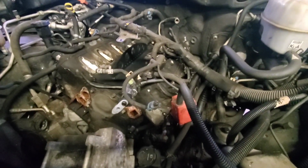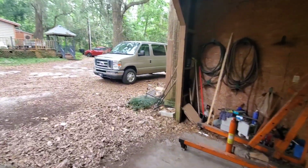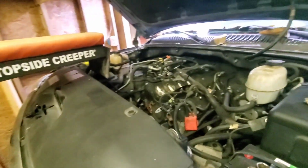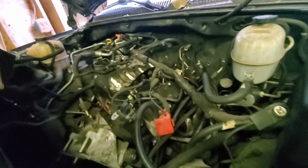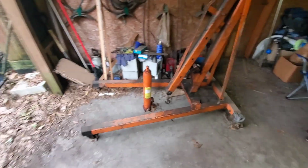But anyway, and I also found a set of Gen 3 pistons and rods that were in really good shape. LQ4 out of the same type engine, and they had bearings still in them. The bearings look like new. The piston skirts had like zero wear on them. They're dirty. I don't know why they would be so dirty, but whatever. They're pistons. They get hot, so I guess the oil kind of burns onto them. But someone took the time to clean the tops of them with a wire wheel or something or other.